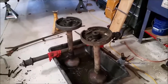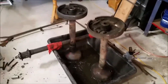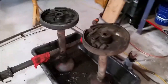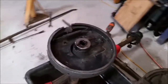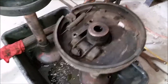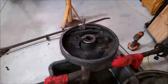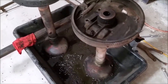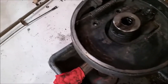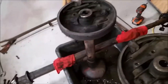I got the axle out last night and split it - didn't have any real trouble with the bolts so it all worked out pretty well. As far as the axle goes, I haven't gotten into the outer bearings yet but nothing was really leaking bad. The driver's side was leaking just a little bit but that's pretty normal. Brakes are in good shape but somebody had one on a little cockeyed so it was actually rubbing the inside of the drum - you can see a shiny spot.